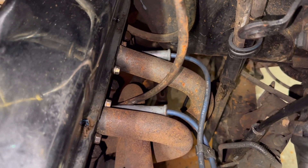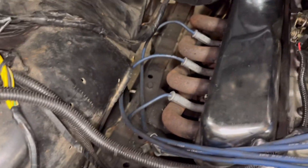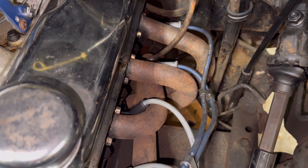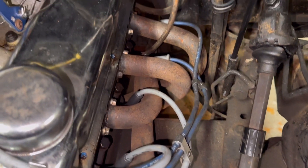I can run my regular straight boots on all the other spark plugs, and I'm gonna have to go back and put a little heat shield on these plug wires so they don't get hot or burnt.